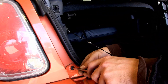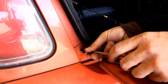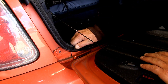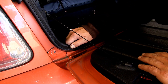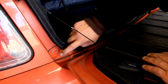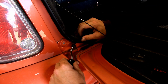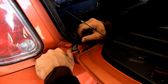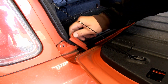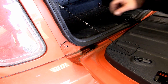There's a fastener on the driver's side and an identical one on the passenger side that we'll also remove. Now because this vehicle is a convertible with an actual door that opens down versus a hatch that opens up, it has a set of hinges. We'll need to remove this cover here before we can remove the bumper cover — gently pry up and out, then it will pull from underneath and remove. We'll set that aside for reinstallation later.